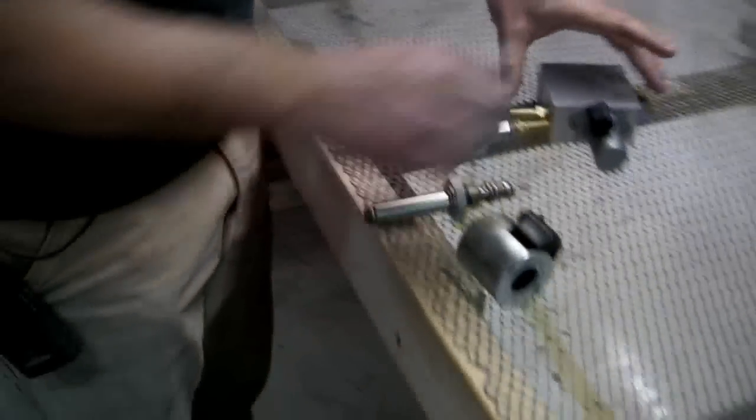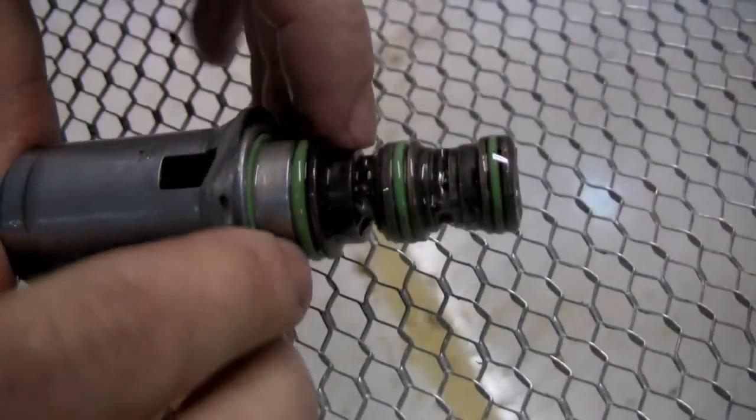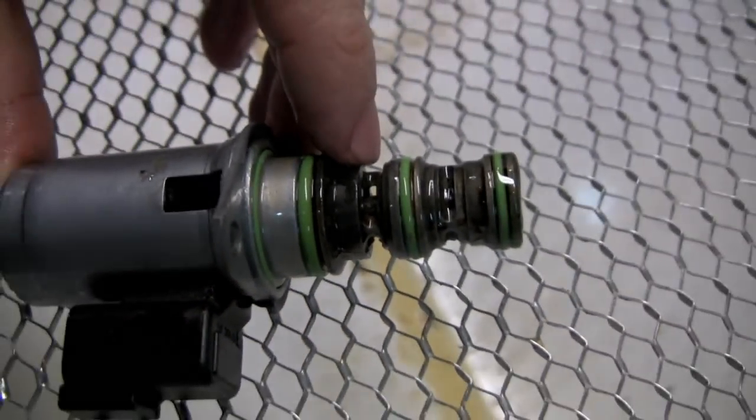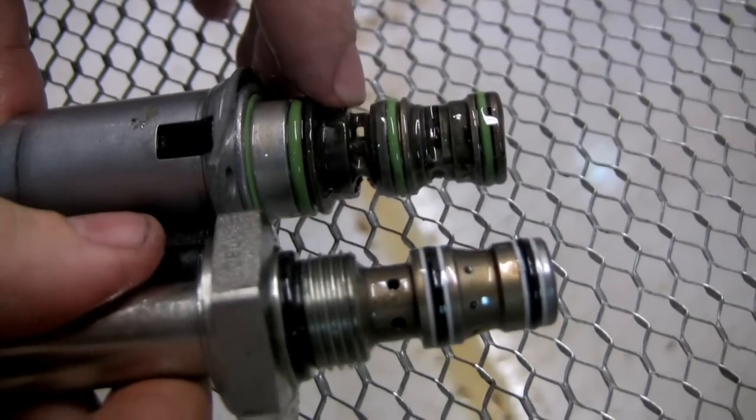You can get a different style that we'd like to point out. We've got elongated slots here, and that's what allows the oil to pass through versus these holes. So this style of HydroForce is going to be a lot less restrictive, but as the numbers show, it's still more restrictive than the other style of valve that we have.